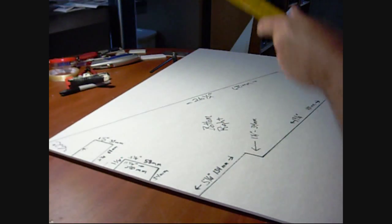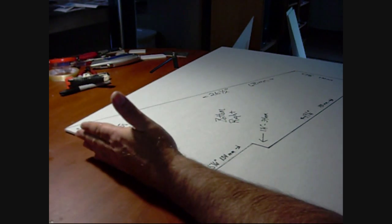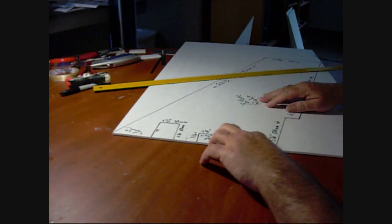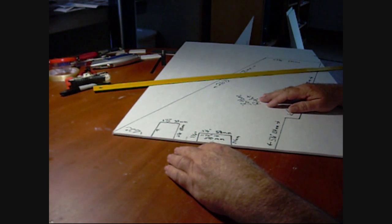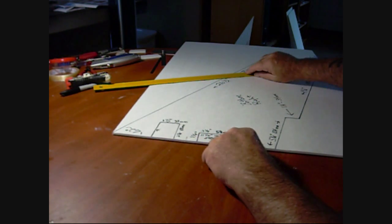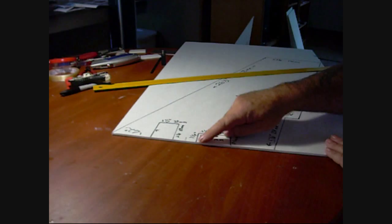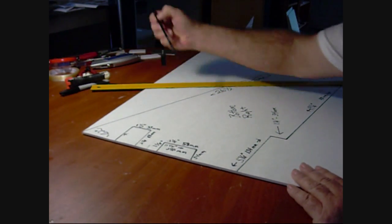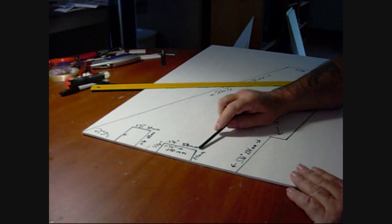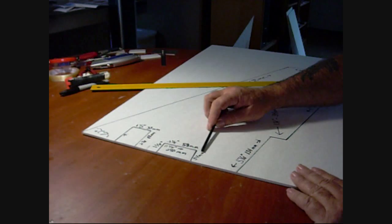This box cutout here is for your speed control and your receiver — we're going to tuck them away so they don't get hurt. On this one we've got two and a quarter inches — that's 58 millimeters — and one and a quarter inches deep this way. One and a quarter inches or 34 millimeters; two and a quarter inches, 58 millimeters. Those will get cut out completely.